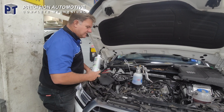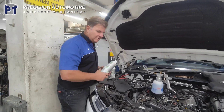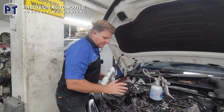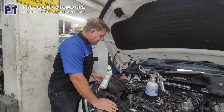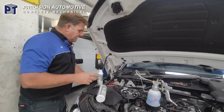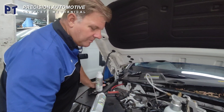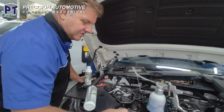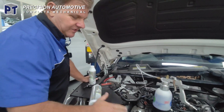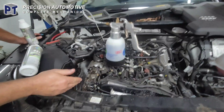It's had problems with the DPF regenerating. We have found an actual issue with the reason why it's not regenerating. There's a feed tube from — it's got AdBlue in this car — a feed tube to the injector which is actually cracked and split. So it was feeding the AdBlue out of the car, not into the DPF.